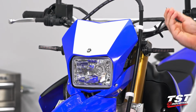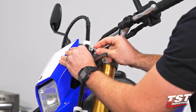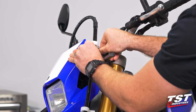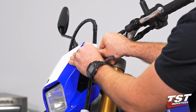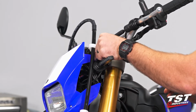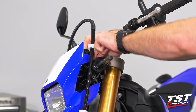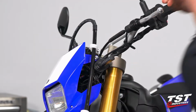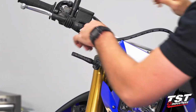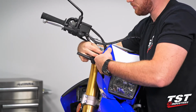I'm going to go ahead and grab our fastener, push our headlight cowl back into place. I'm going to start these by hand, then grab my tool again. This is a frame component, so I would suggest that you start it by hand. Just because if you strip that, you're not going to have a fun time. Same thing on this side.